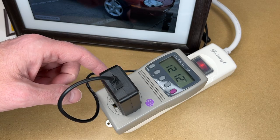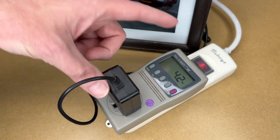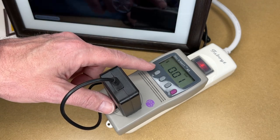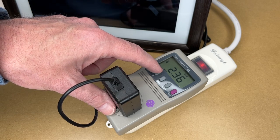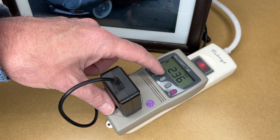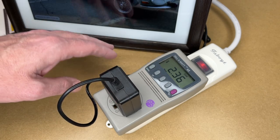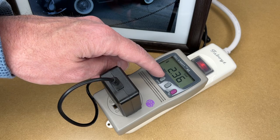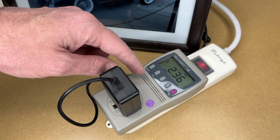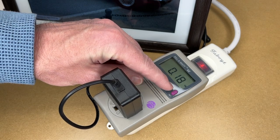I've had the frame plugged into an energy monitor. It's taking 4.9 to 4.2 watts — it's jumping around a little bit. So far it's cost one penny, but let's extrapolate: over a year this would cost about two dollars and 36 cents, based on 9 cents per kilowatt hour, with the frame turning off at 11 p.m. and on at 7 a.m. I don't want anyone to expect they'll pay this exact amount — this is just a ballpark. It's used 0.18 kilowatt hours so far.